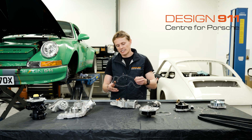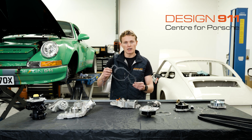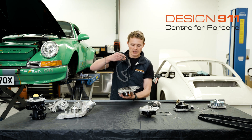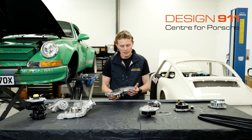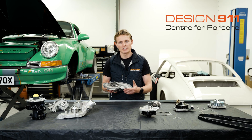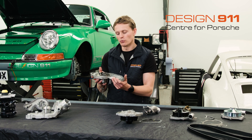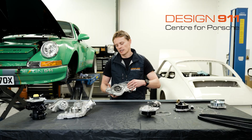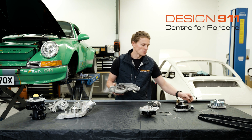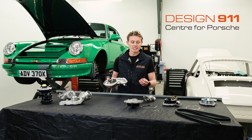With the water pumps, you also get gaskets. When you install your water pump, there is a gasket that goes between the housing of the water pump and your engine. The gasket failing can be another cause of coolant leaking. If your gasket has failed, you can simply remove the water pump, take off the old gasket, put on a new one, and refit the pump. For different water pumps there are different gaskets — this is a fibre gasket, and this one is a steel gasket.